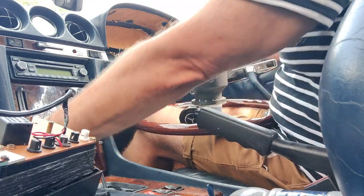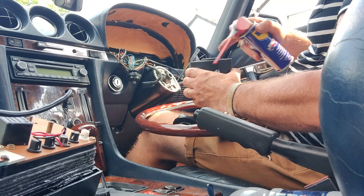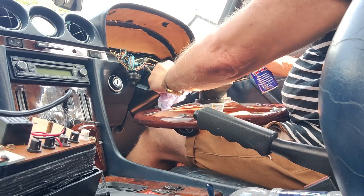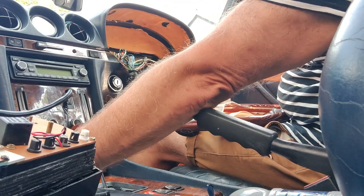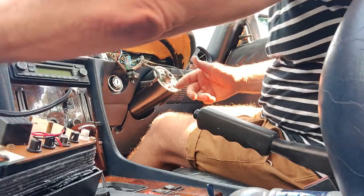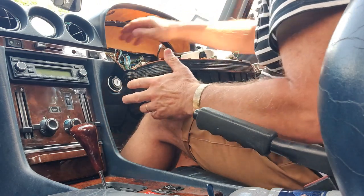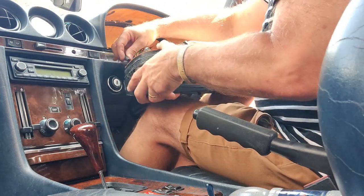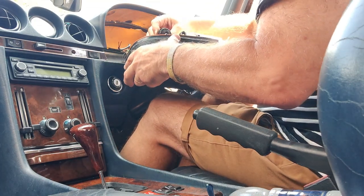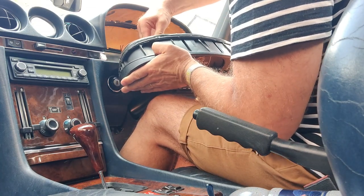Okay, so here we are going to put this dash back in. Just before we do that, take the opportunity to just clean up the contact wheels on the steering wheel and the two copper sprung contacts, which are on the steering column there. Okay, so we can now reconnect the speedo. So what I'm going to do first is reconnect this large connector first of all,